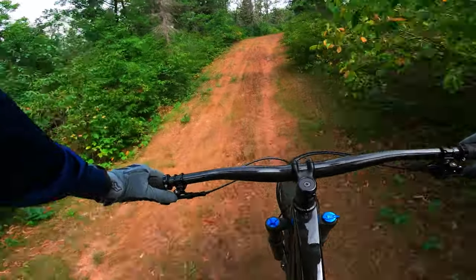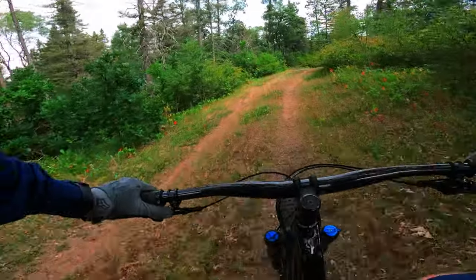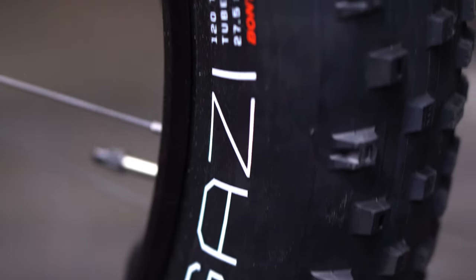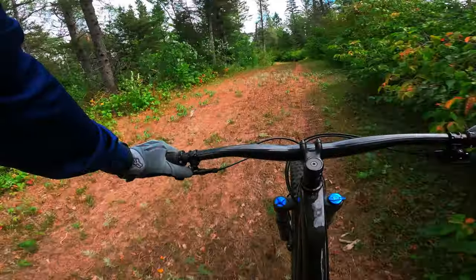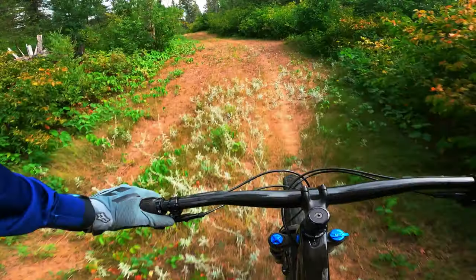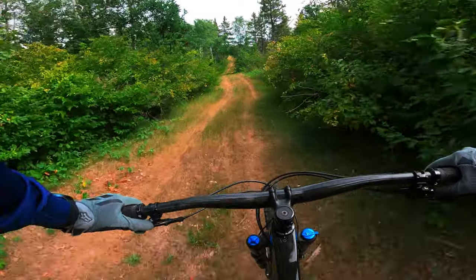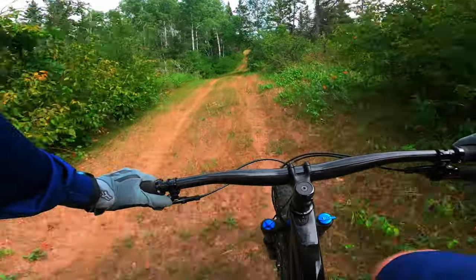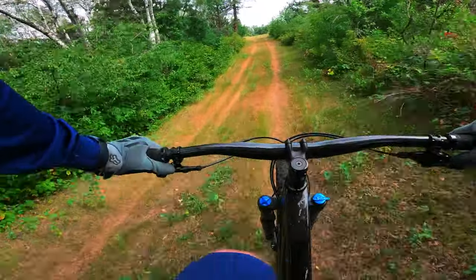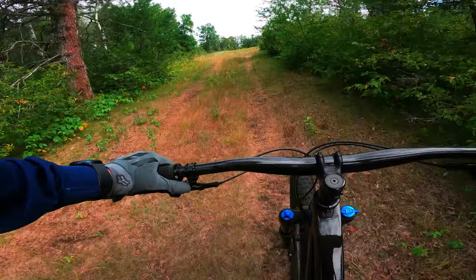It's built for speed and it's going to roll fast. Depending on what size you get, you'll get a variety of tire sizes. On the large and bigger frames you go to 4.5s on the front and rear, and on the medium you go to a 3.8 on the rear. There might be just enough clearance for a bigger tire on the rear, but at lower pressures you're risking tire touching the frame. Right off the bat it might look like a mullet bike because of that tire size difference — the rims stay the same but the tire is completely different.